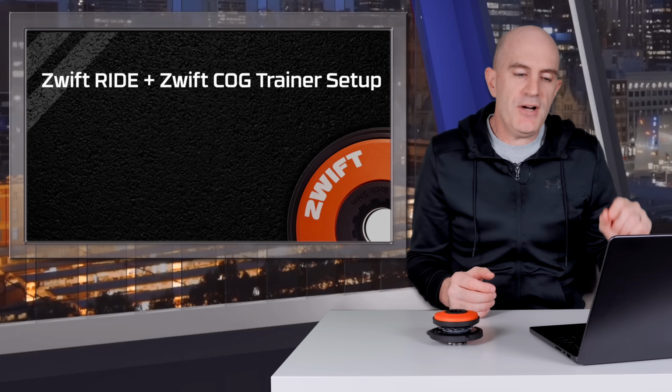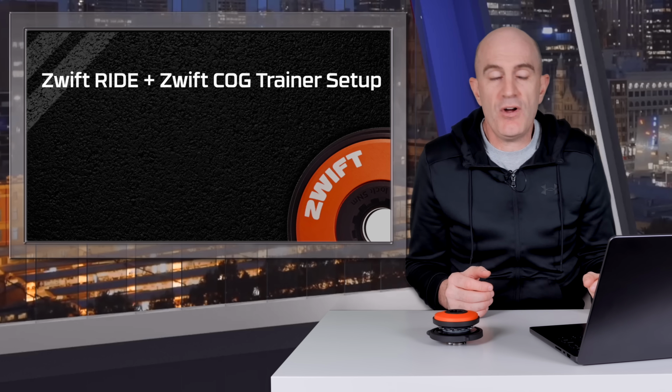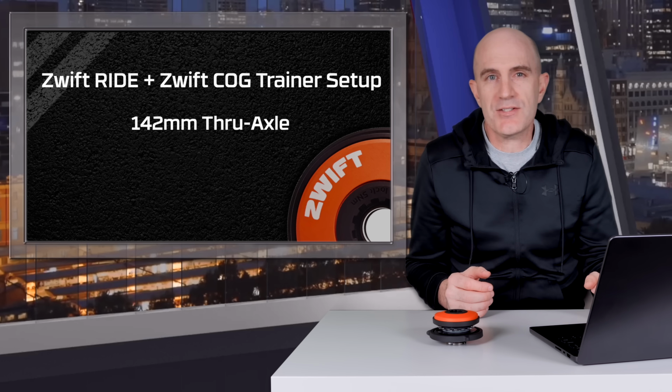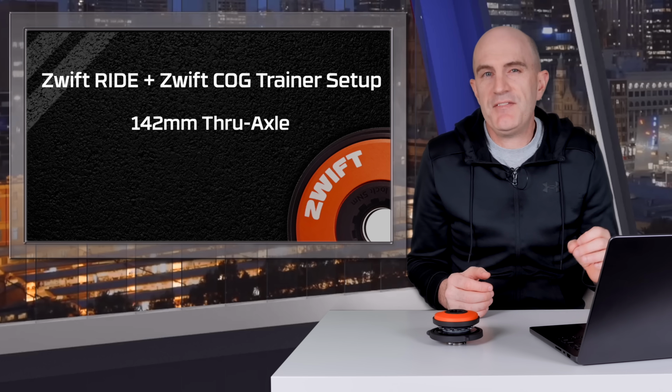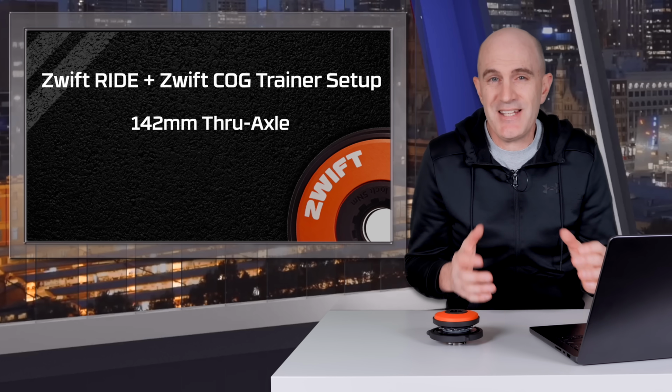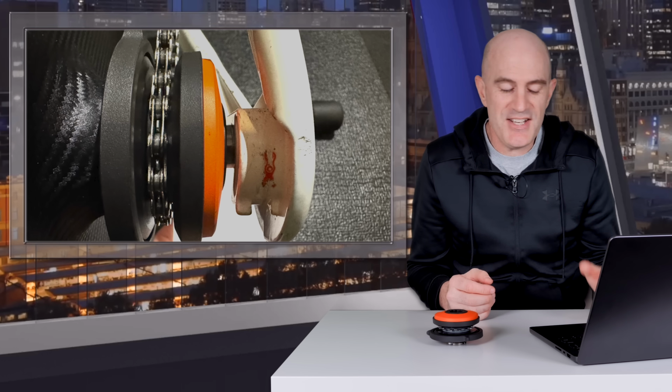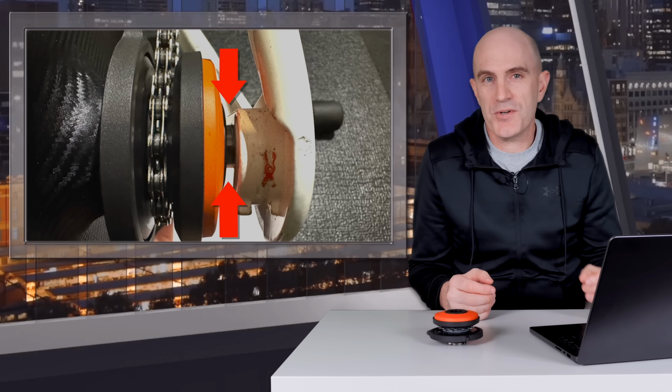Next up, how do I configure my trainer for the Zwift COG and Zwift RIDE frame? You'll need to configure your trainer for 142mm through axle configuration. Each trainer will have their own end caps or adapters to use to get it into that configuration, and it's really important to use those adapters too. There needs to be enough room for the frame and the COG to spin.